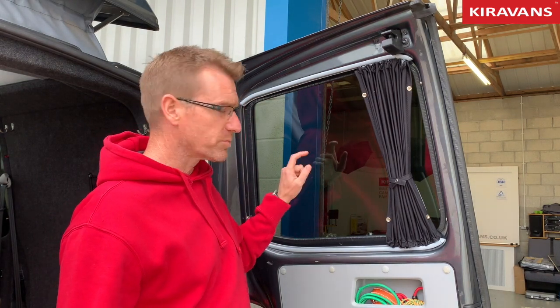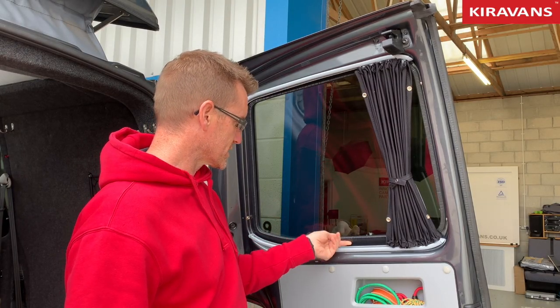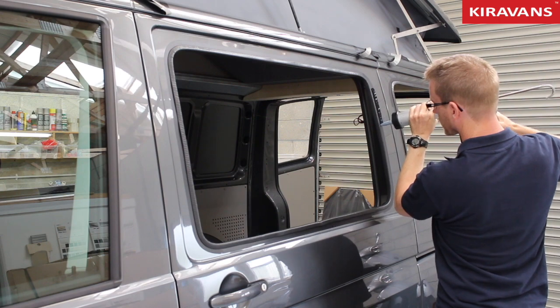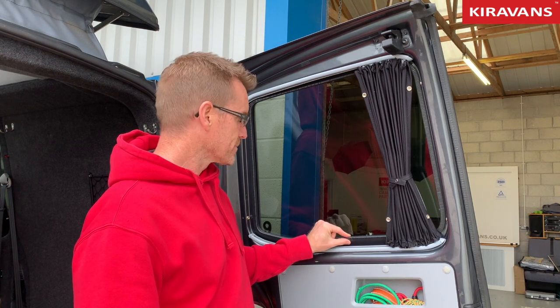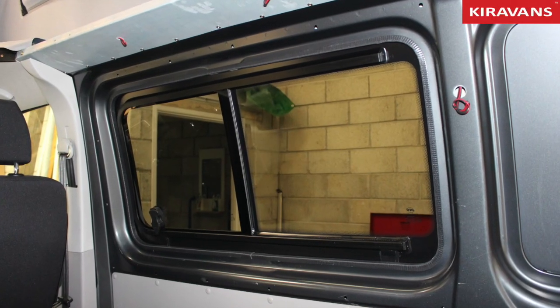This is for if you've put your glass in already and you've got your knock-on edge trim. When you put this on it's in there pretty solidly, because in between the glass and the trim it contacts the adhesive, so it would take a lot of work to get that out — so that stays in there. If you're doing this project on your own, quite likely you'll put the windows in first and then come back and do the lining a bit later on.